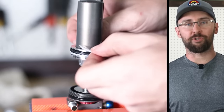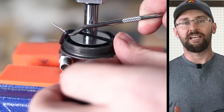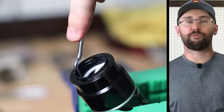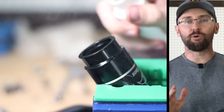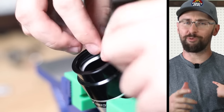These O-rings can be pretty difficult to remove, especially on the air can. I found it's best to grab a metal pick and stab directly through the O-ring to easily hook them out, but still be super careful not to nick the metal and damage any part of the shock. Also pay close attention to the order of the O-rings — if you can take it apart, you can put it back together.